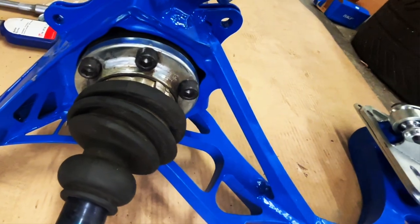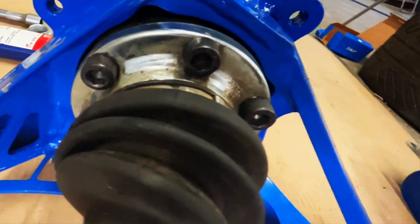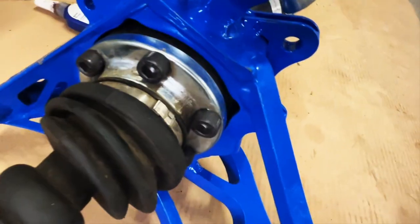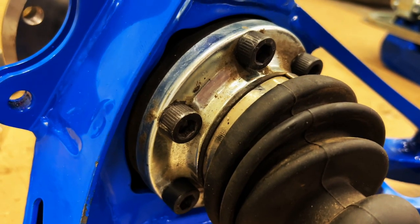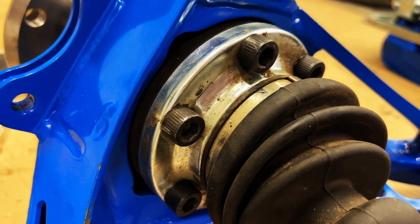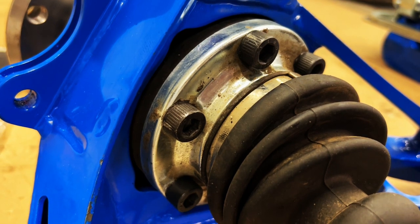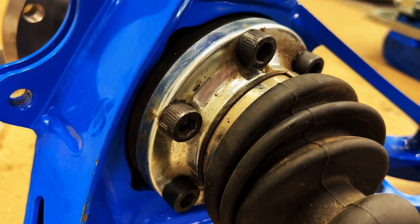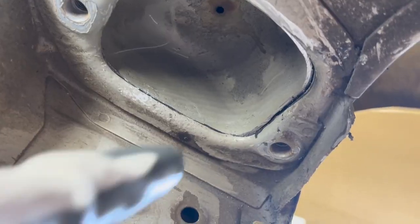These are designed to work with the strongest BMW OEM axles, which are the M3 axles. We're using our own Einzel axle here, which is a little different from OEM, but that issue has been solved — you can run any BMW M3 or any large-spline BMW axle in this hub, no problem. Of course, Wisefab axles will fit as well. If you have any questions about this kit — about the axles, or which calipers or rotors to run — send us an email or comment below.